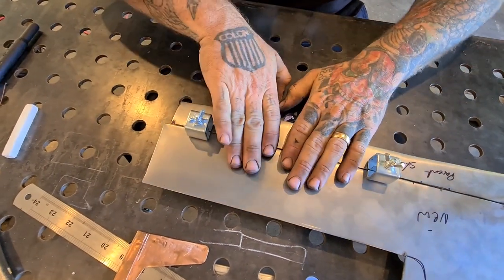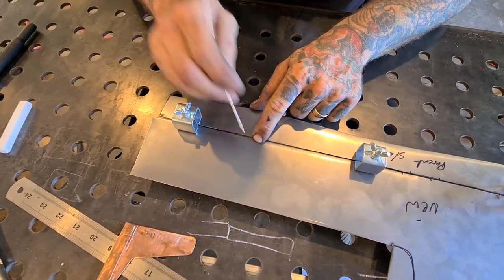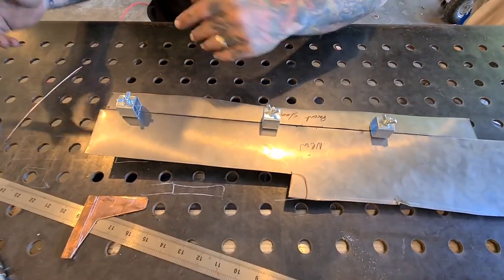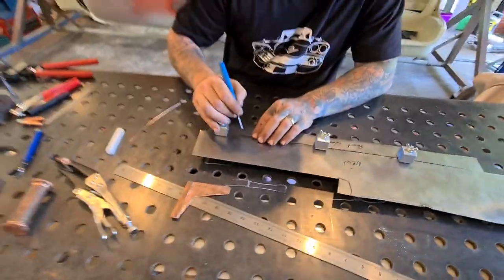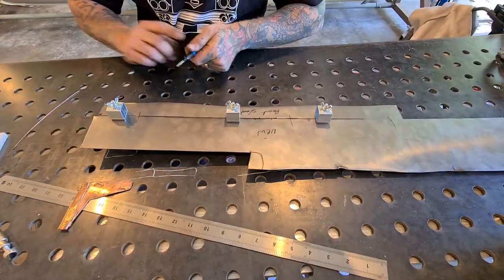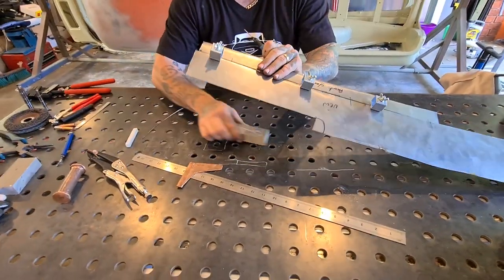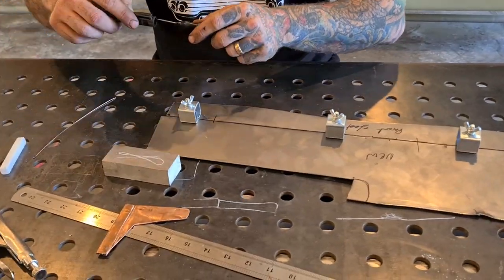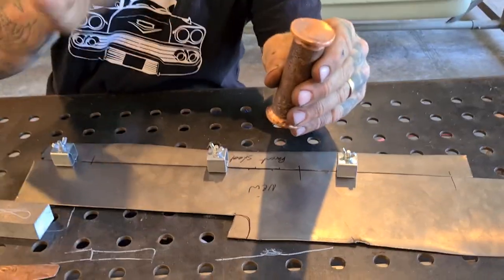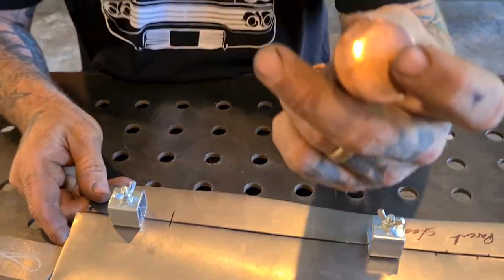You want to keep your panel at a temperature where you can always touch it with your hand without it being too hot. Tack here, blow it down with an air gun, jump over there, tack, blow it down, keep jumping around. Don't be afraid to mark your panel up in stages so you know where you're at. Keep following the pattern: tack, let it cool, move, tack, let it cool, move. If you're spot welding with aluminium or copper backing blocks, another tool I've got is a bit of solid copper rod — domed on one side and concave on the other — so it works on all different panel shapes.